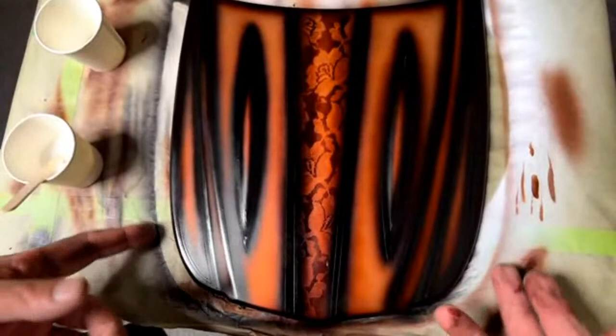And then another question. Someone said, would cleaning down whatever you're painting with urethane reducer help the paint to stick better? Probably not. You just use wax and grease remover. This was already pre-painted with orange, and I knew I didn't touch it with greasy hands, so there was no need to do that. But yeah, definitely wax and grease remover will get off any contaminants that would cause adhesion problems like that.